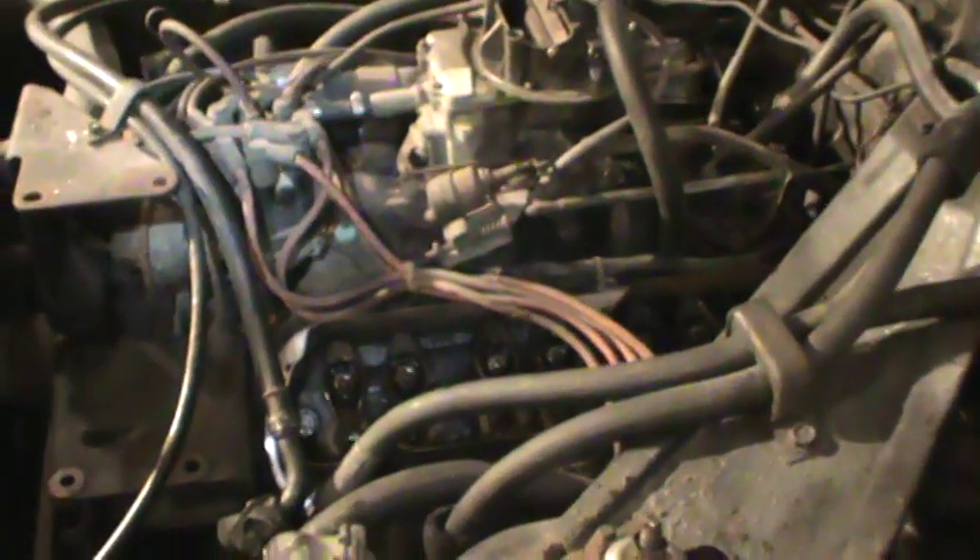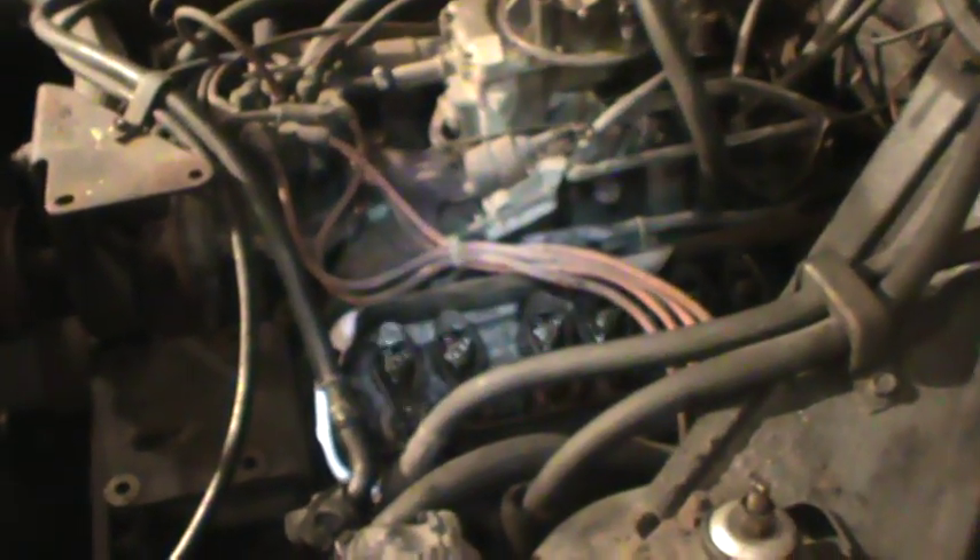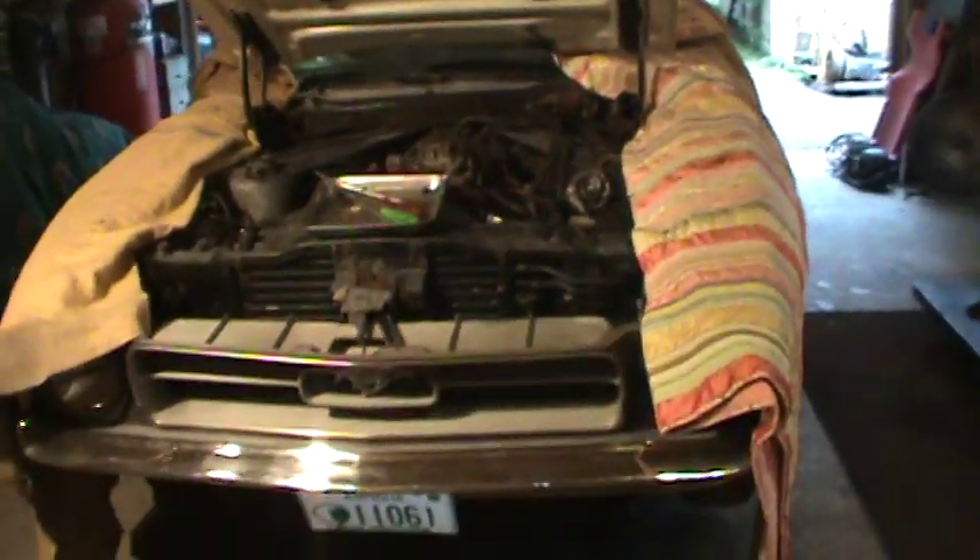So with that, that's what the process is. The same process actually holds true for Chevy motors that have adjustable valves — I don't know exactly what the spec is between half and three-quarter, but I have a feeling it's probably pretty close to that. That's the process of adjusting the valves while the motor's running. Thanks for watching — if you like my videos, please subscribe and I'll make more.